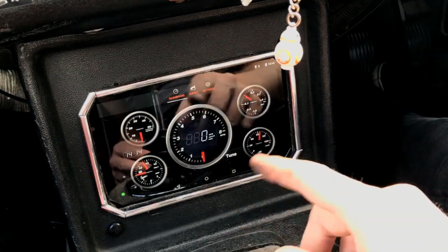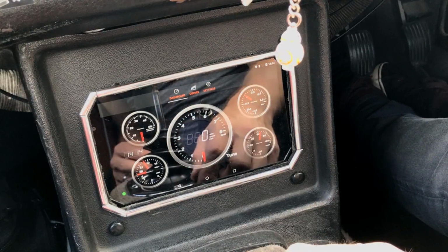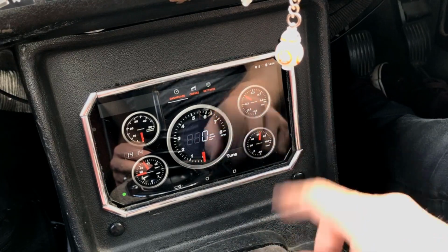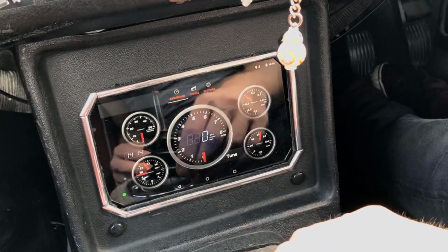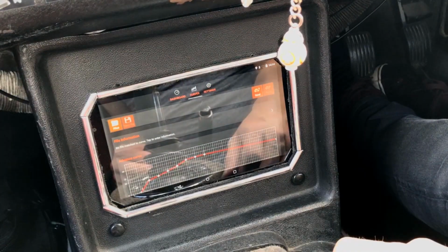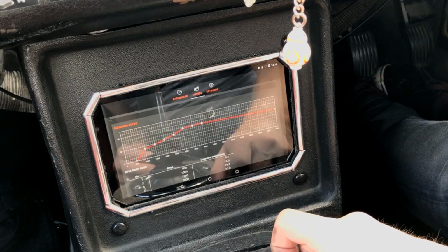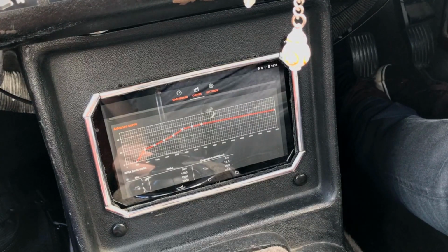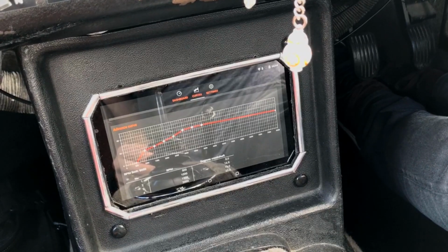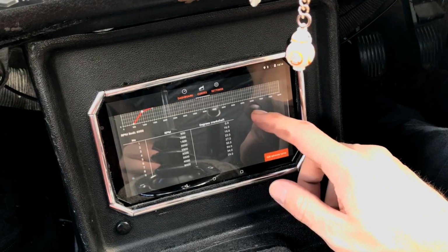And this is the dashboard, which I've sort of shown in other videos. There's a GPS speedo in the middle, rev counter, amongst other things. So battery voltage and temperature and vacuum and degrees of advance, etc. If you click on the middle icon, it's curves, and this is the advanced curve that I've currently got, and it goes flat when it gets to about 3,500 revs, and then sort of tapers off, which I don't know is actually particularly good. Oh, here we go, degrees, crankshaft degrees.